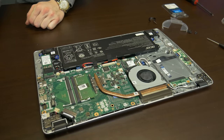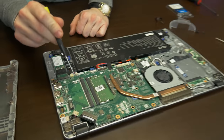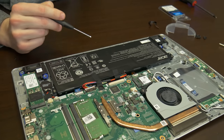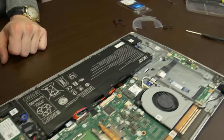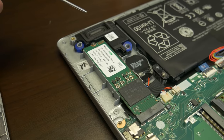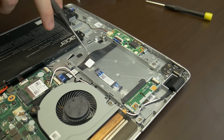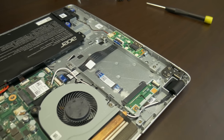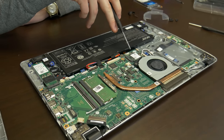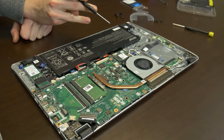With the back panel off, it's a nice one-piece design. There's the second DIMM slot for the RAM upgrade, the battery which is serviceable but requires disconnecting some ribbon cables. There's a standard M.2 SSD that can be upgraded — you could probably put a one-terabyte drive in. There's also a conventional 2.5-inch SSD bay where you could literally add one. There's also a Wi-Fi M.2 adapter that's serviceable. There are actually a lot of upgrade options on this board, which looks really good for the price.